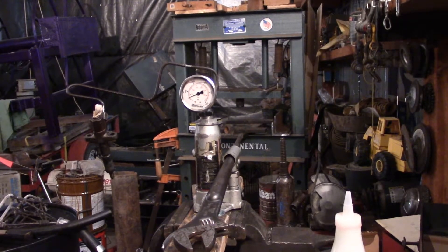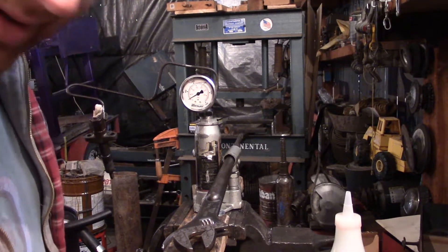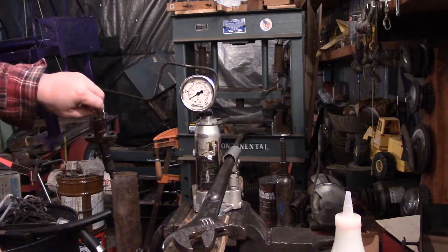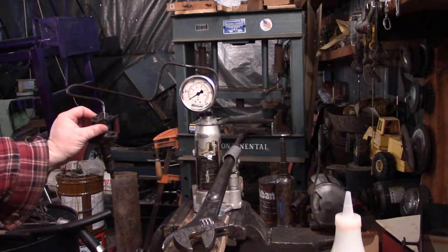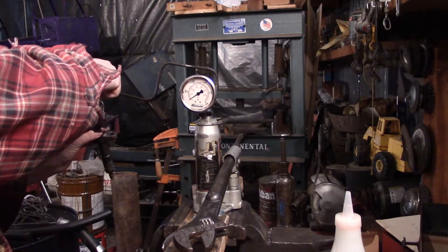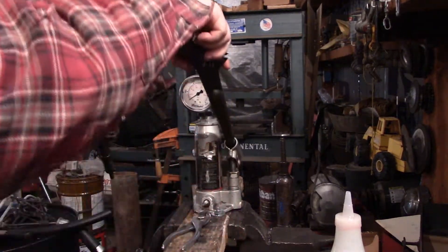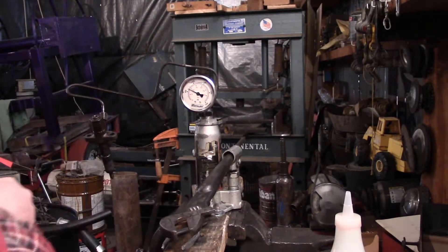Pop pressure is a little low, so we're going to start cranking her up. Got my Allen wrench here — I buried it somewhere, here it goes. This one's got an adjustable spring on it. Reach to the top here, tighten down the screw a little bit. I'm going to take a look at how that one goes and close it.